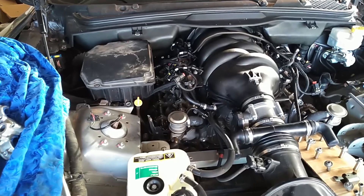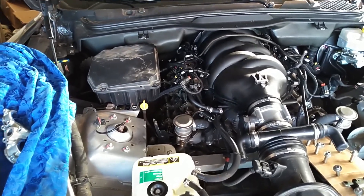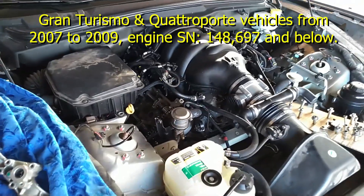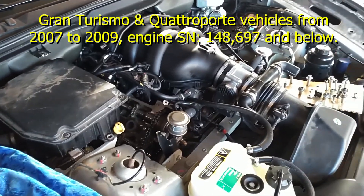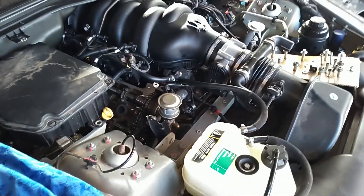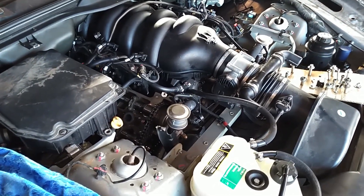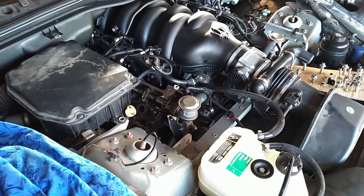This car has a built-broke situation where if you don't have a certain modification done to your cam holders to help oil stay on top of the head after the engine cools off, you may have wear in your cam variators — one on this side, one on the other side. If that wear begins to happen, you will likely get noise on cold starts and/or continuous rattling in your engine.